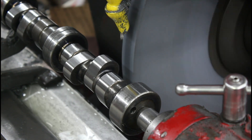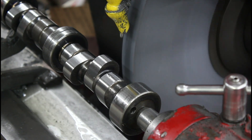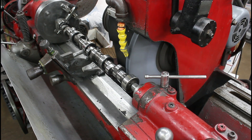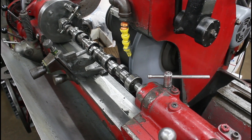So that's how we do it. We'll finish out the exhaust — roughing them — then fine dress the wheel, run the whole pattern again, and then we're finished. We take the cam over to the cam doctor and run it through, and that generates a cam card. The customer will have hot lash settings on the card and it'll give all the durations, lobe lift, and lift at the valve. We show the durations at multiple different intervals — that's how we do it.